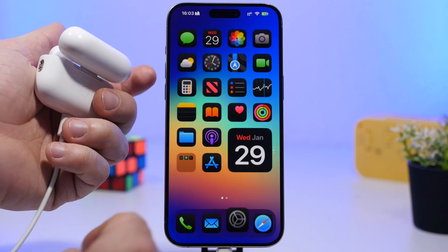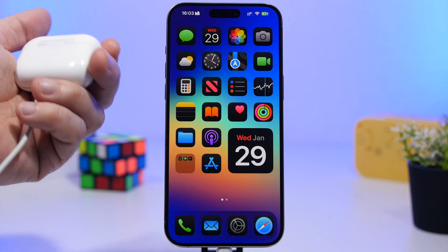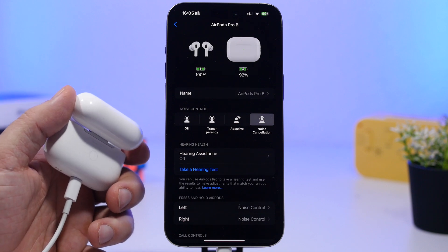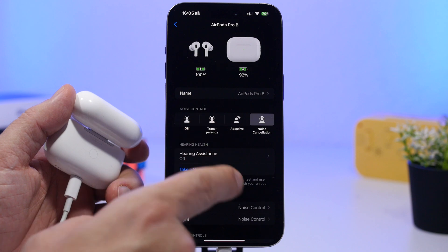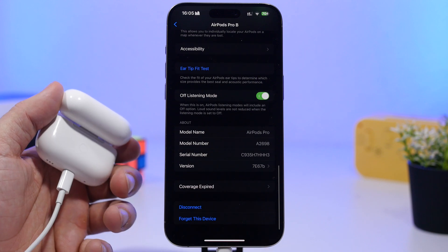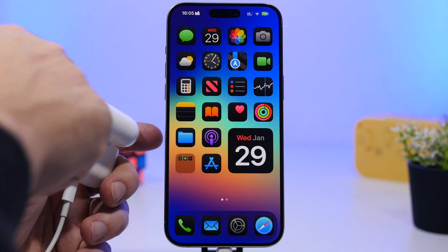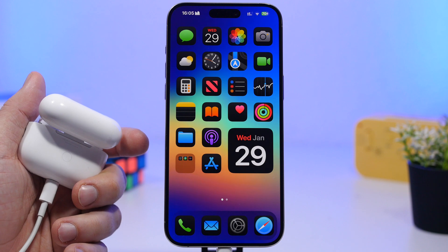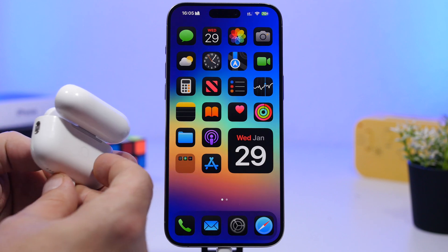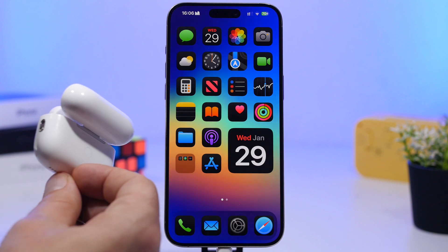As I said at the beginning, according to Apple, if this doesn't work, you will need to reset your AirPods and try again. Here is how to reset them: go to your iPhone, go to your Bluetooth section, and tap the 'I' button next to the name of your AirPods. Then forget or disconnect this device from your iPhone. Once done, place your AirPods in the case and close the lid for 30 seconds. Then, if you have AirPods 4 or any model with the button on the front, open the lid and tap three times on the front button — you will see an amber flashing light.